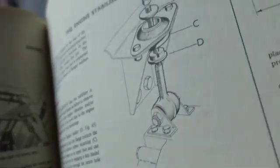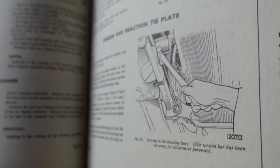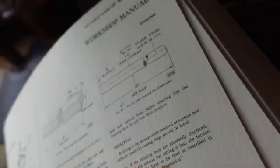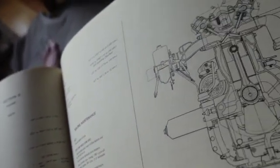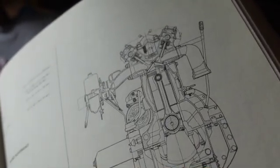And there's that rear motor mount. I'll try to remember to show you that. And then the torsion bar reaction plate. Yeah, she has torsion bars, and it's not too difficult, but you got to let the wheels hang down so far when it's on a jack, and then put your torsion bars in, and then let it down and measure the height and go from there. It's not too bad. A lot of cars use torsion bar. I think Mopar cars did a lot of that.